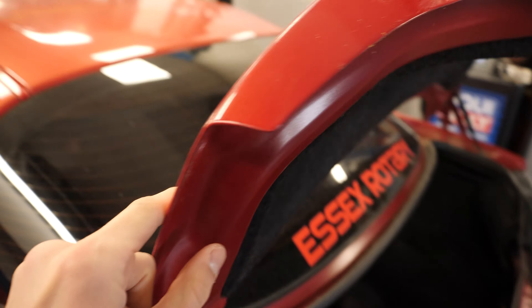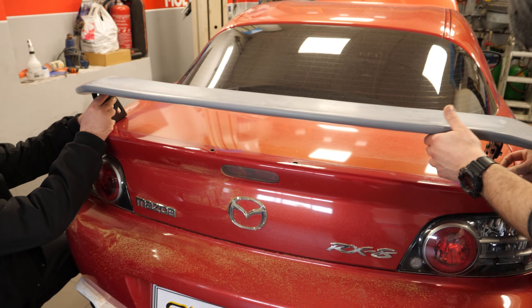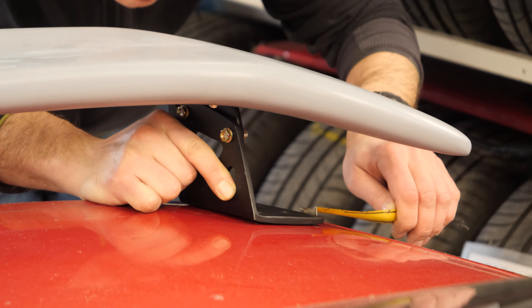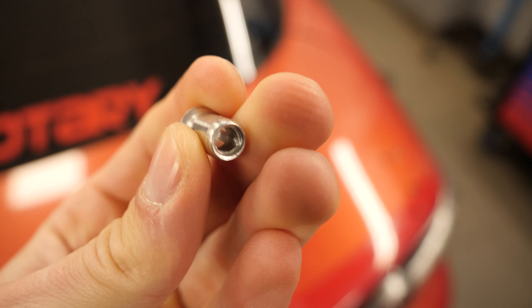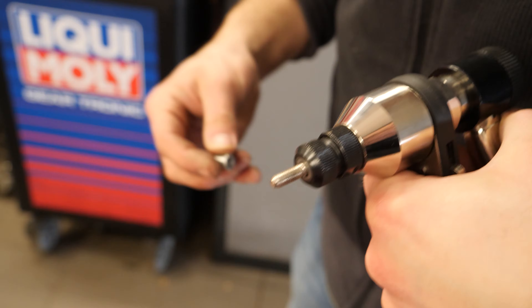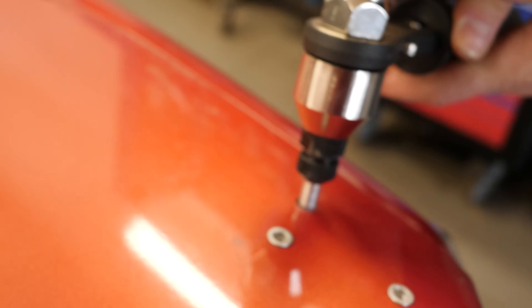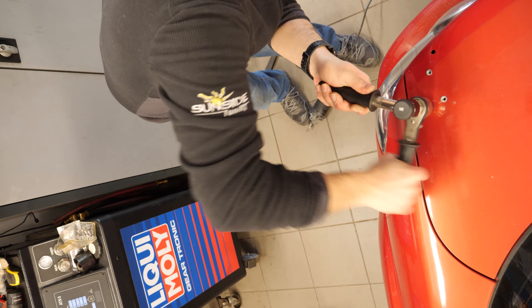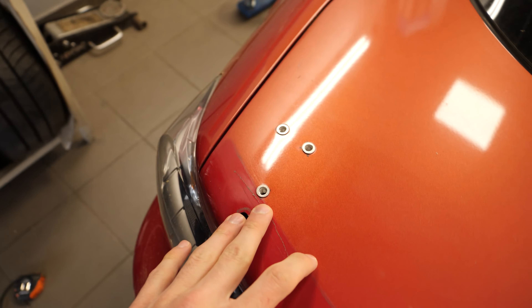We were very lucky that the holes didn't penetrate the boot. So now it's time to reposition the spoiler and measure the sides so that they are of equal length. Next, we'll take rivet nuts for M6 bolts and put one in each hole that we drilled. We put the rivet nut on the rivet gun, insert it in the hole, and then secure it in place. The rivet nuts are in on this side and also on the other one.